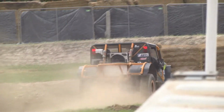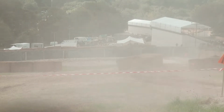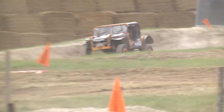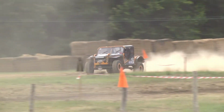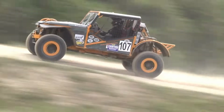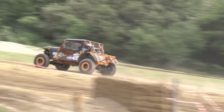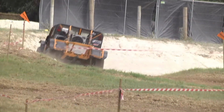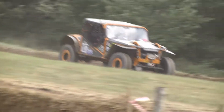Well, the cars are much physically bigger in America. They run practically around 2 tons, 2.25 tons, whereas our cars are running between 1 and 1.25 tons, generally speaking. If you try and put too much power through the smaller shafts, you will end up exploding them if you hit a hole hard on full power, typically. But if you're running slightly less power, it's more likely to be kinder on the transmissions.